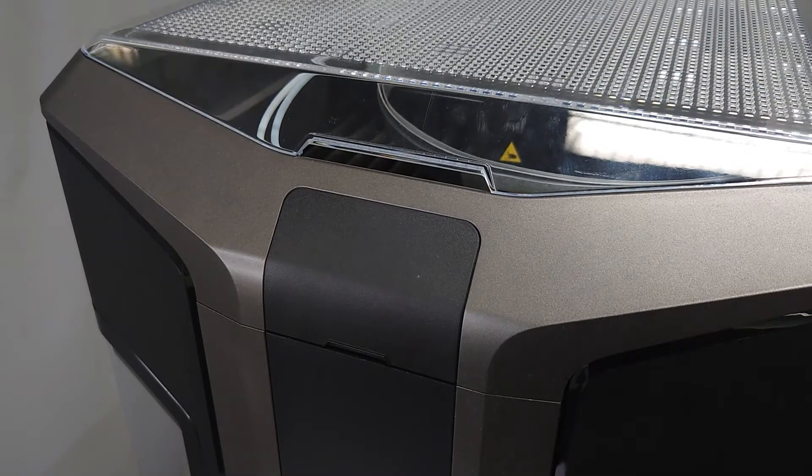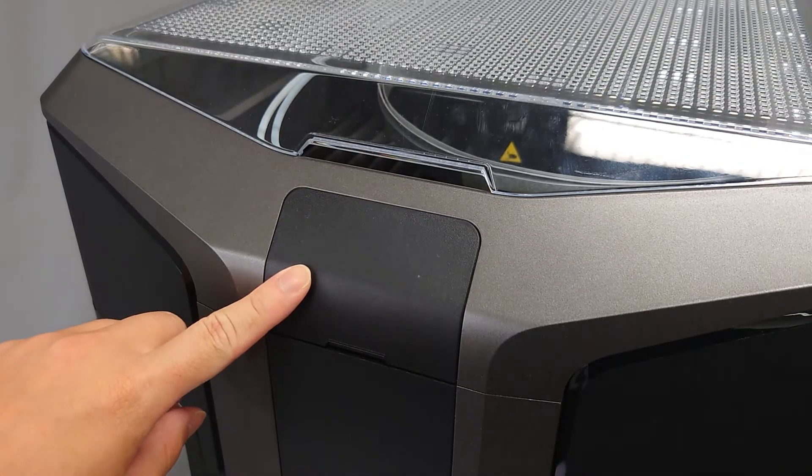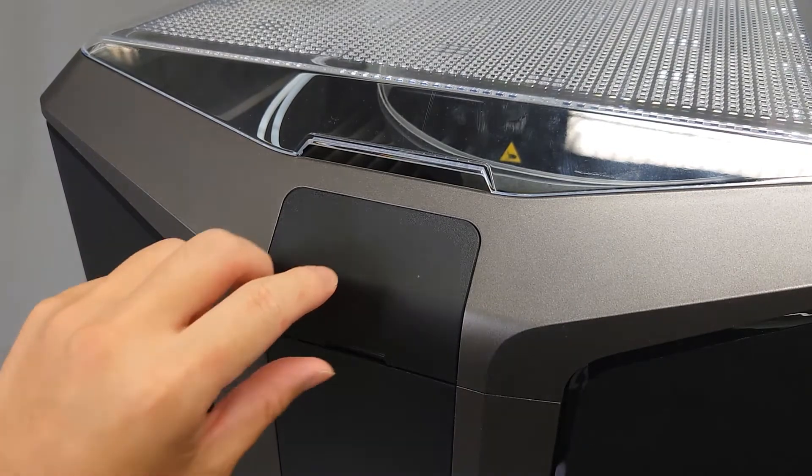Follow the guide tube to the left interior side of your Method. On the outside of the Method, you'll see a hidden plastic cover which is removable. Remove it by pulling away from the bottom tab.